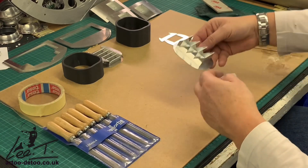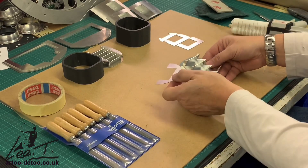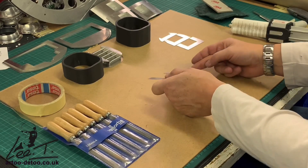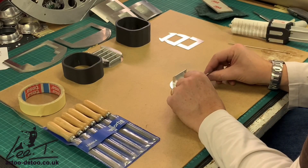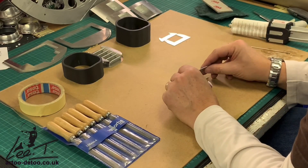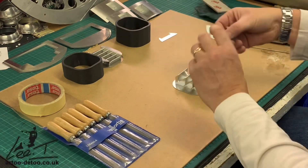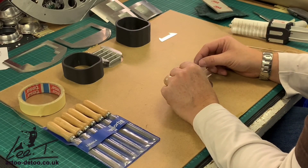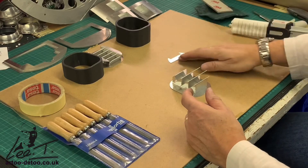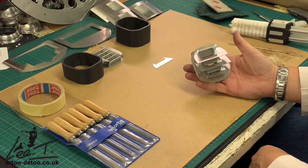There are some locating slots that go beyond these plates here, and the vanes will locate into the slots. They go in the order you see here — I'm going to do them from bottom to top, and there's a reason for that which you'll see in a minute. So this is the bottom part, this one is your second up part, and then the next part. We pause there and leave this till the very last once everything else is glued together, because this is a bit of an awkward one to do. It stays square — you can't get it out of line really.